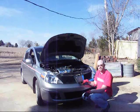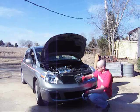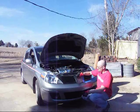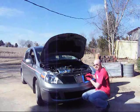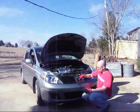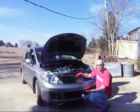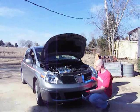They recommend using a pencil, marking a score mark here, just lightly, and up along the side. And then from that mark, once you take the grill off, you can lay down tape. You're going to lay it to the inside of that mark about 1/8 of an inch. That way you're not going to do roughly to the paint here, but you're going to be behind the grill. That way you won't see the flat black and it'll look natural like it's supposed to be there.